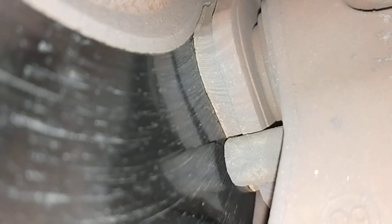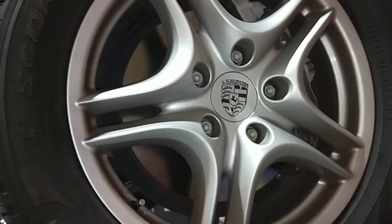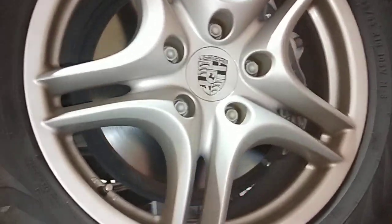I have checked the service book — the car is due for a minor service and a brake fluid flush change. Coming to the front, let's have a look at the actual brake pads. There are your brake pads — it's about 2mm until you touch the actual housing. So even though the brake pads seem thick, there's only 2mm left until the actual wire touches the disc and brings the warning light on.